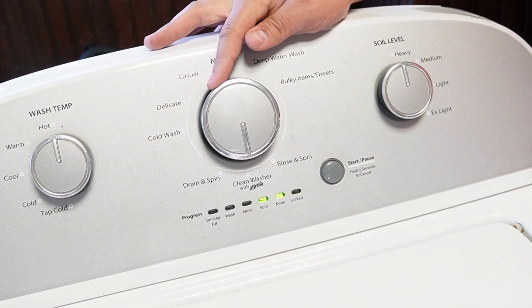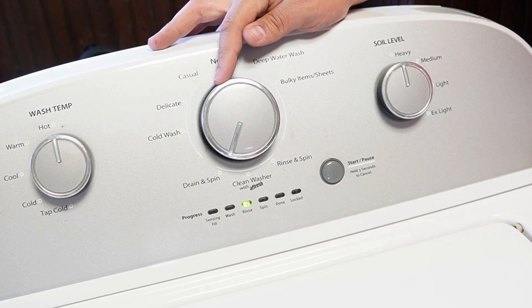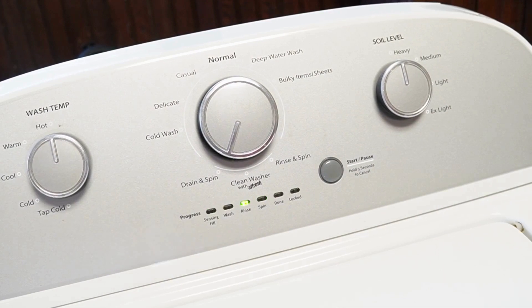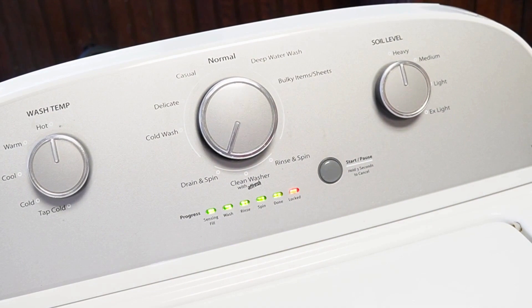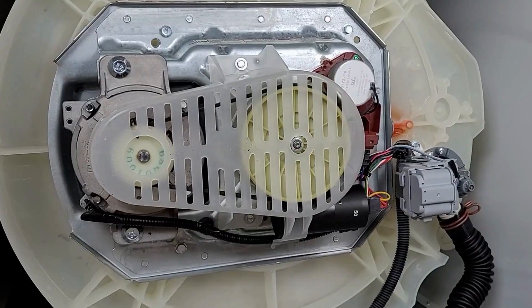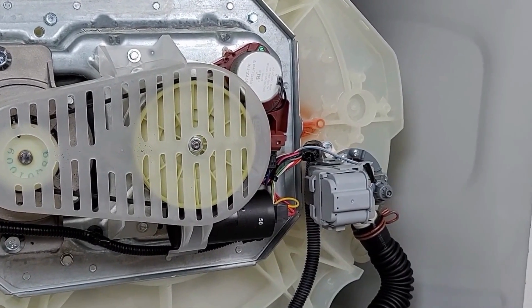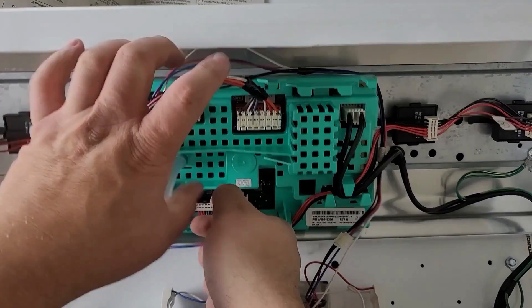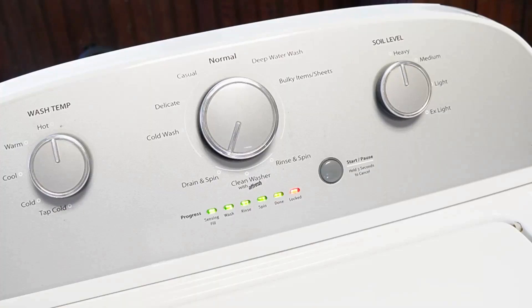Once you're in this mode, turn the knob clockwise four times. The rinse light should be the only one illuminated solidly by itself — this is the recalibration mode. Once you press the start button on the rinse mode, the door lid will lock and it will begin a series of tests and operations on your washing machine. All these tests take approximately three minutes to run all the way through. As the recalibration mode runs, every part and process on this washing machine is going to be run, and the machine will physically reset all the components to a default state, allowing them to run at an optimal level. This is a must-have when parts aren't working right, or the machine just doesn't know what state it's in — like if you've replaced the shift actuator or even a control board. You're going to hear all kinds of noises from the machine, and that's going to be totally normal. When the calibration mode is at the end, every single light is going to turn off, including the lid lock light, and the machine is now ready and recalibrated for use at an optimal level.